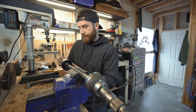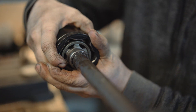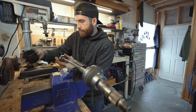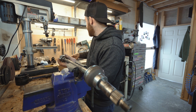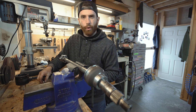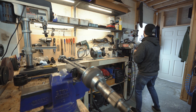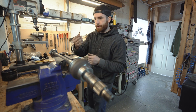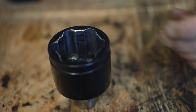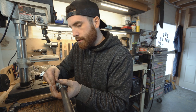It's got this outer race here and this goes into the transmission — imagine the differential is right here. If I pull this out, it should come by hand and you'll notice there are ball bearings inside. These ball bearings should just pop out. This particular cage is worn out so they're falling out. Usually you need to take a small screwdriver and from the backside, pop out the ball bearings. Make sure not to lose these as you pop them out.